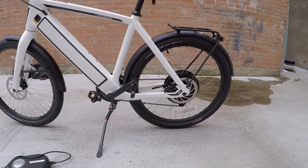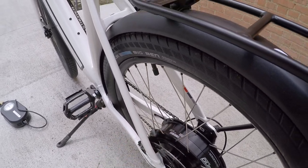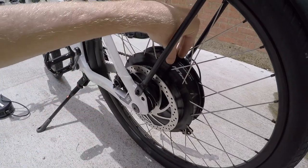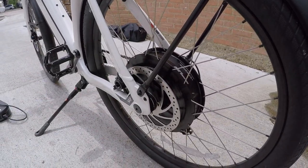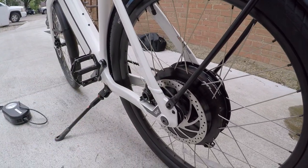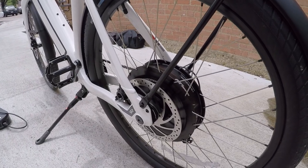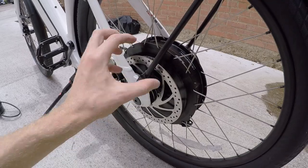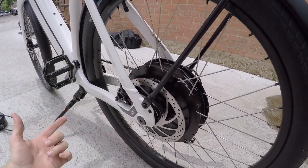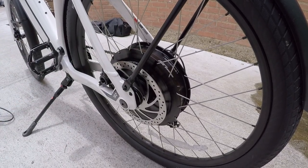Not just because of the design, but because the motor is so quiet. This is a Sino Drive from TDCM — 500 watt nominal direct drive gearless rear hub motor. There really aren't any moving parts inside: just magnets around the perimeter of the hub. When electricity from the battery is sent by the controller, it's like an electromagnet repelling those magnets — that's what makes you go. Compared to a geared motor with planetary gears, the direct drive is smoother and longer lasting, though it is heavier at around eight pounds.